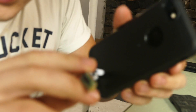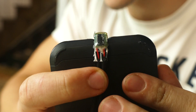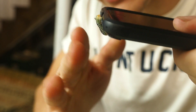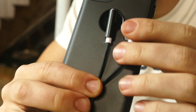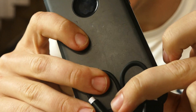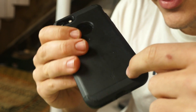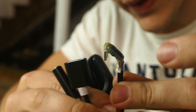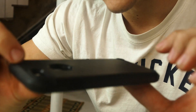What this allows you to do is wrap the cable around the phone so the phone plugs in like that, and the cable wraps around into the back, where you can mount the headphone jack and the charging port. So all you've got to do is grab your case, throw your phone in just like a cheap case you can buy that you don't mind messing up a little bit. Grab your modified cable — link's in the description of where you can get this type of cable for pretty cheap. Just plug it into the phone like that, and you can see there's almost no bump out. On the back you have your aux cord and your lightning adapter. You'd just glue these in place and glue them to the bottom, and maybe throw some plastic covering over the bottom. I'm basically creating a 3D printed cover to fit over this, but that could be substituted for any sort of plastic that is the same color as your case. Don't let the 3D printer stop you from trying to create this.